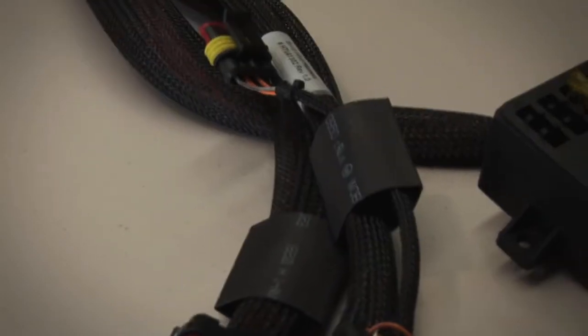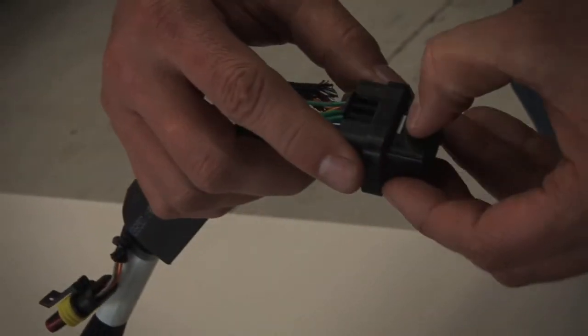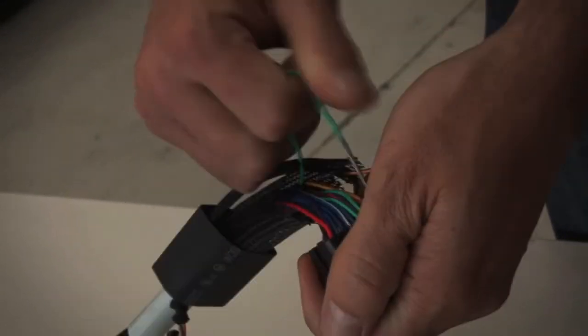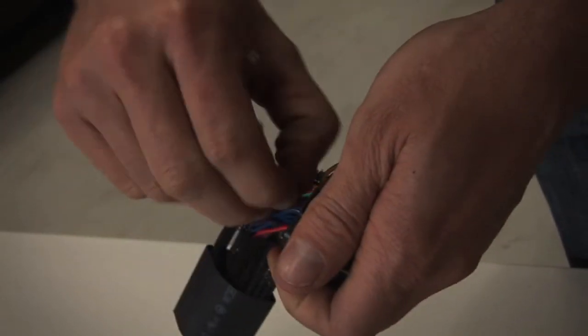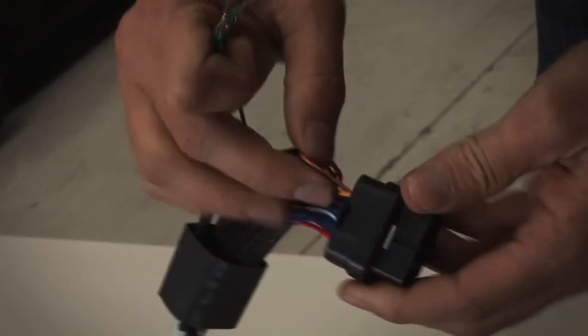This makes for a nice clean install with not a great deal of excessive wire. You'll notice on the wiring harness that the heat shrink that's been added has not yet been shrunk down. The reason for this is so you can easily take wires out of the harness before you install it for a clean install. To actually remove wires from the main ECU connector, you need to depress the lock tab. You'll hear it click — once it's clicked and the two tabs are out on the bottom side you can actually remove the pins. They require a little bit of force, but when they come out that's what they look like. I'm going to remove all four wires from the idle speed stepper motor circuit, and once all four wires have been removed we'll lock the harness back in place and the pins won't come out.